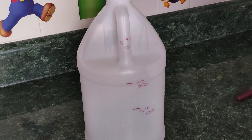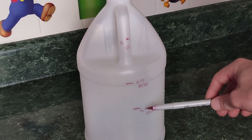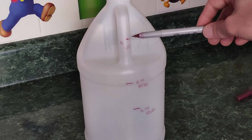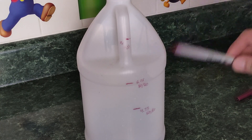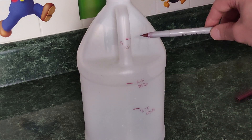It needs to be distilled water — not tap water, not any other kind. Distilled only. The reason is that water naturally has minerals in it, especially tap water, which has calcium, iron, potassium, chlorine, and other stuff. You do not want that in your engine — it will turn into mineral deposits and cause all sorts of problems. Distilled water is available at any grocery store for about a dollar a gallon. After filling to the methanol mark, fill the remainder with distilled water to the full mark.